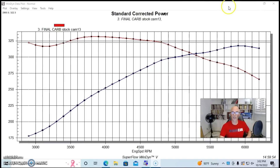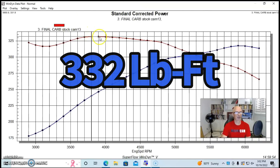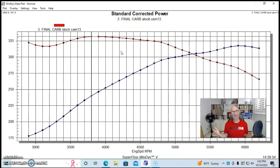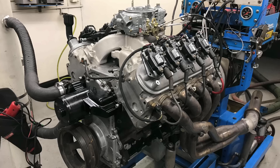We ended up making fairly good power. It made 318 horsepower - with a little whittling, 320 was probably in sight - and 332 foot-pounds of torque. So not only did it run, it actually ran fairly well, which can mean only one thing: now I have a working 4.8 liter dyno test motor, which means I have to do more testing. Make sure to like, share, subscribe, ring the bell, do all that stuff. I love it when a plan comes together, but now that I have a 4.8, I'll do more testing.